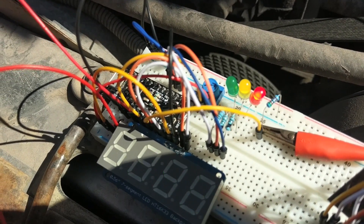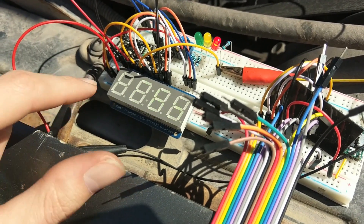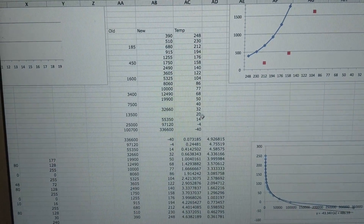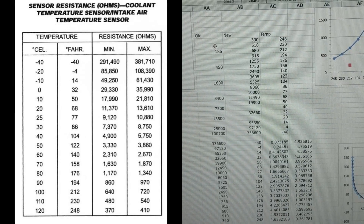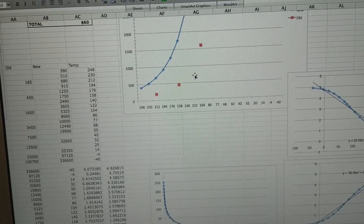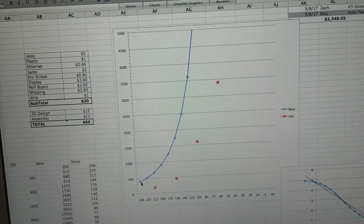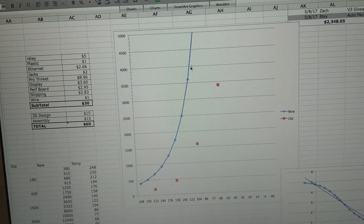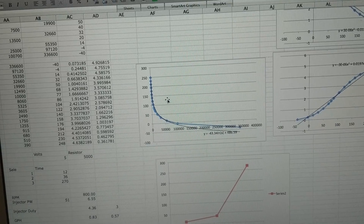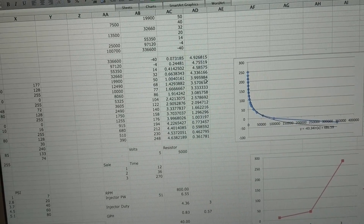Our raw reading is like 263, but now we play the guessing game: if we have our resistance curve right, we figure out the calculation and turn that into an actual reading. If you browse hard enough on the internet, you can find a temperature chart that shows the temperature and resistance range for that sensor. This blue line is our new temperature sender. As the temperature goes down, the resistance goes up - it goes up pretty high, pretty fast. As the temperature rises, the resistance lowers.